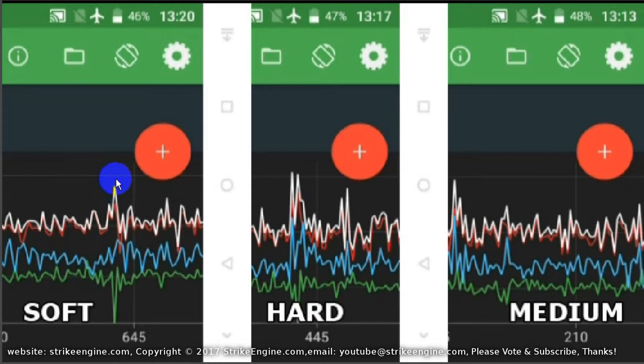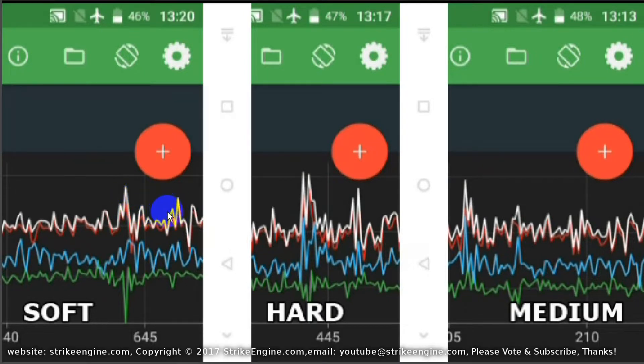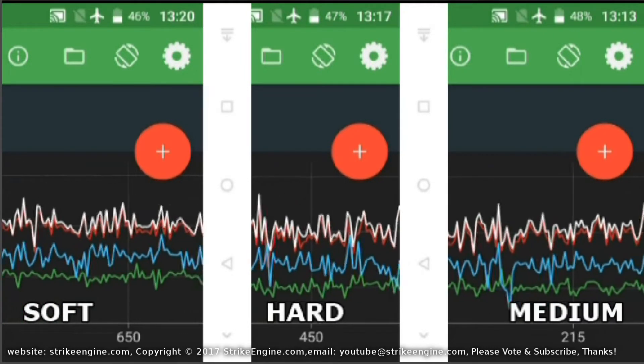At this bump you can see the soft is below the line, the hard is above the line, and the medium is quite close to the line. We're expecting two bumps — one when the front axle goes over the bump and one when the rear does. With the hard dampers you've got quite a big spike for both axles; the medium shows less on the rear; and the soft rear is about the same as the medium. So there is some difference visible here.